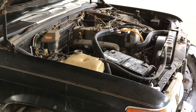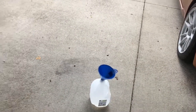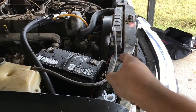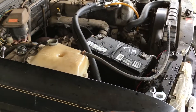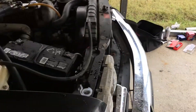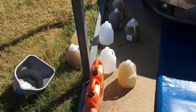So the car's turned on, I'm letting it recirculate. It's sucking down water, I'm going to continue to add more, and then I'm going to flush. I'm also going to go to the parts store and pick up a thermostat seal and do the thermostat. Run it, let it get warm, recirculate, you can drive it, redrain it, refill it, drain it again. Crystal clear. Look at the jugs — how much we drained out. I did like five flushes, they're really gross.